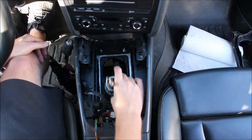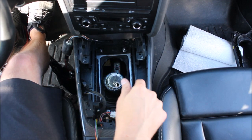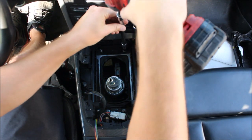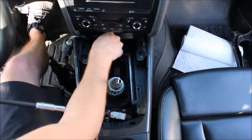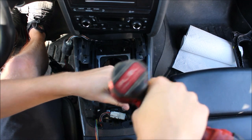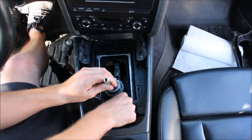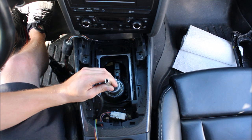Now that this is done, you should be able to slide freely on the top bolt mounting point and also on the bottom, so you can slide the whole thing all around. We're going to drop the plate — don't use power tools. Four nuts — have a magnet handy. I'm really trying not to drop anything down into this hole; it's a pain to get back. If you're lucky it'll drop on the ground — if not it'll be stuck on top of the heat shield.